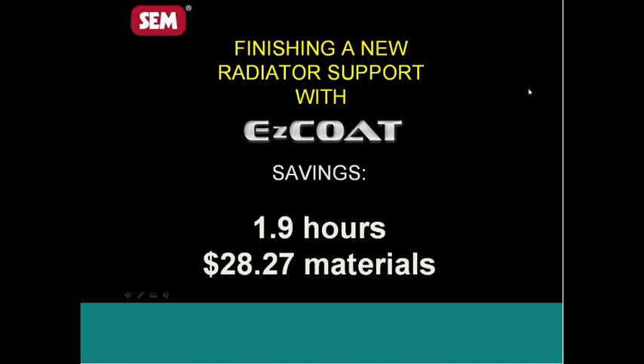As we go through these slides, we're going to break that down and show what we can do with the two products we're talking about. The current way — before EasyCoat — was for the tech to walk over to the paint shop, stop what he was doing, mix up primer in a three-ounce lid with a liner. He would take it back to the body shop, spray it, and hopefully the job was small enough to get done with three ounces or less. For a bigger job he'd need more. Then he walks back to the paint shop, dumps unused product, cleans the gun, mixes the correct color, puts that in a separate lid and liner, walks back to the body department, and sprays the color. Then he has to go back and clean it all up again.